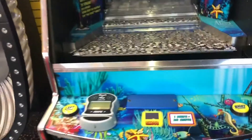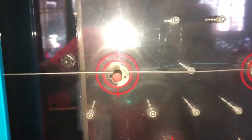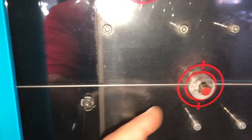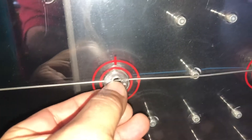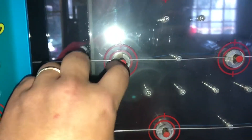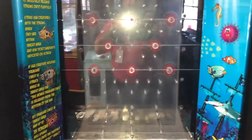Today we have a Deep Sea Treasure issue. One of the little plastic hold-downs that holds the wire is halfway broken, and the one underneath it has lost its pin completely. We're going to replace this pin, remove this piece, fill it up as best as possible, put a new one on, and slap this game back together. These pins are important — if they're not hitting the little metal sensor, it'll never go off. Let me go ahead and take this apart.